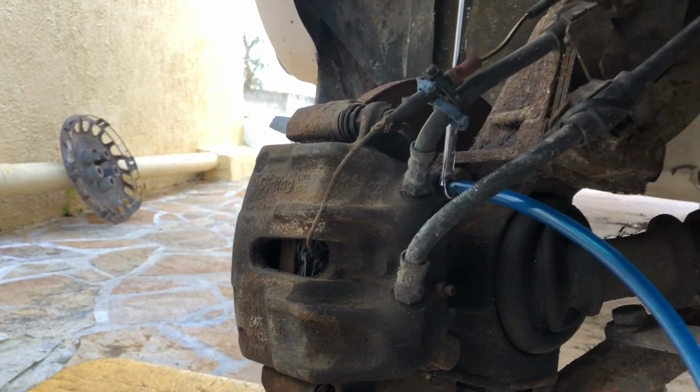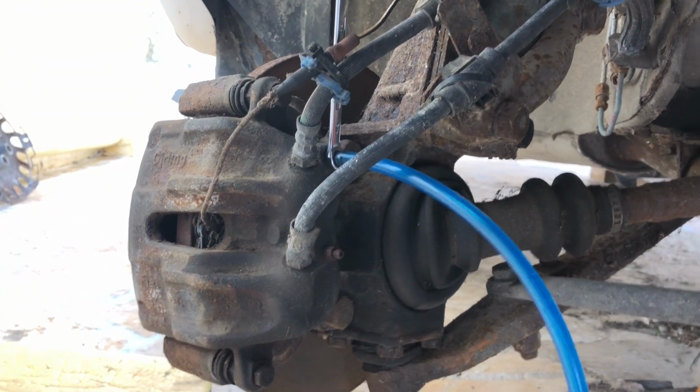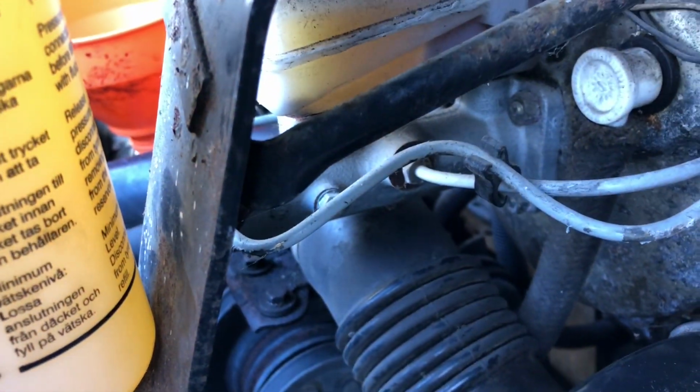Now, you may have noticed, those who know about brakes, I've got 2 hoses there, and I've got 2 bleed nipples, and it's the same on the other side. So I mentioned earlier that these things are a sort of mix of commercial and domestic. I've not really seen a PLG car like this. So what this has, it's got a 3-circuit system. Your car will have a 2-circuit system. So here we are, we've got 1, 2, and then round here there's a 3rd pressure connection.